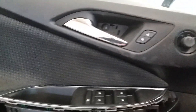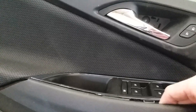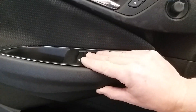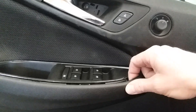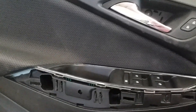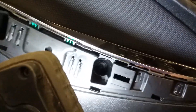The next difficult thing is to get this trim piece off around your window switches. It goes in like that and then pops on. So you want to be able to get something in between the chrome on your window switches and this piece and pry slowly backwards all the way, then slide this out forward. And then down in here you've got holes.